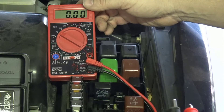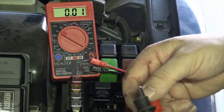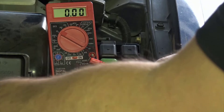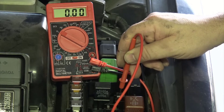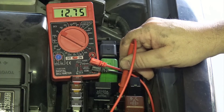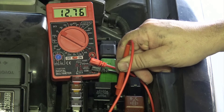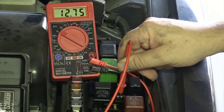Now I've set the meter to measure volts, and I have the open location where the horn relay was. I'm going to see if it has power at all the appropriate spots. I'll leave one alligator clip on, and this one's going to go straight to the negative battery terminal. Using the other probe to carefully probe and test the relay connections, I can see on the switch circuit I have 12.75 volts going to the switch side. My control circuit also has 12.75 volts going to it, so I have power on both terminals that should have power.